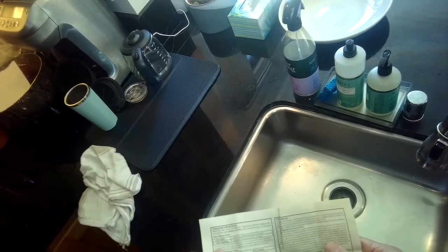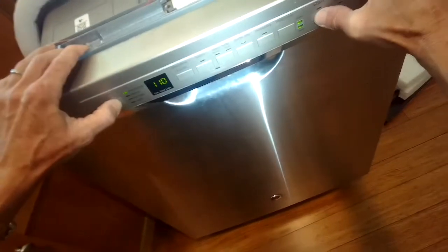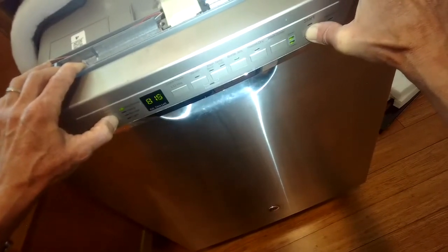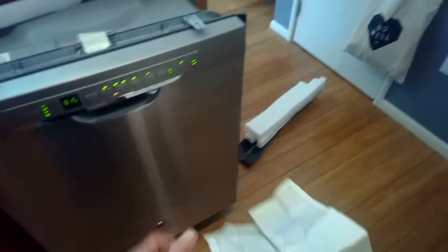That's just probably part of the circuit on the main controller that is damaged and is not able to see that the door is locked. The cycle select button is on the left and the start button is on the right — press and hold them for five seconds. We get '815' on the display and a bunch of blinking lights, meaning the controller thinks the door is still open, which it is not.